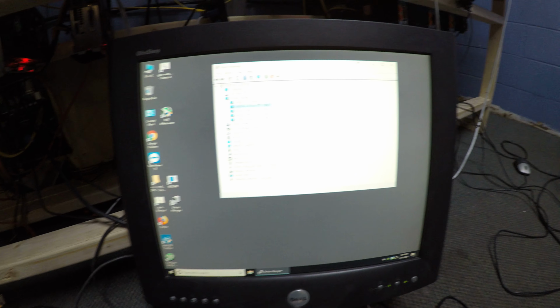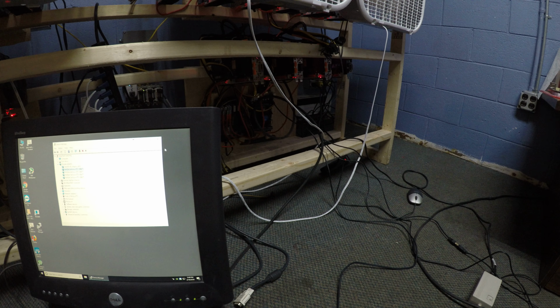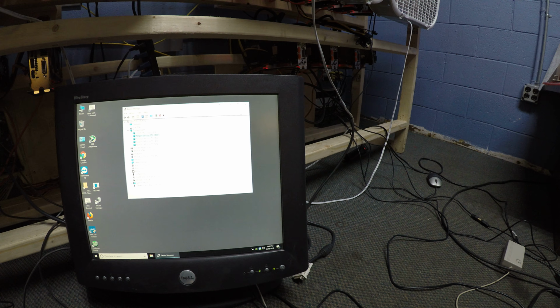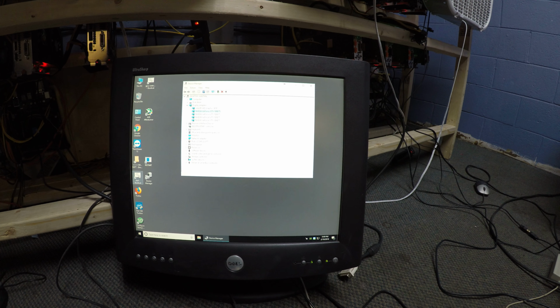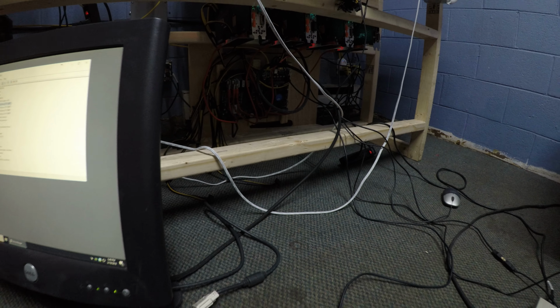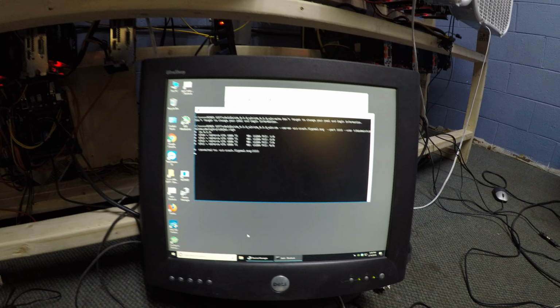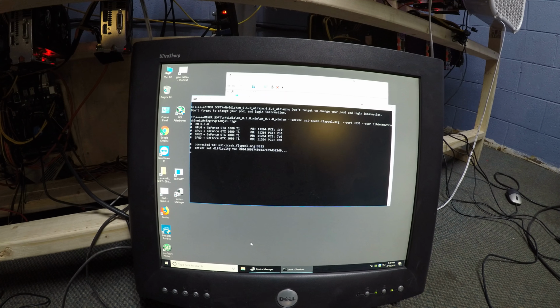Okay, here we go. I finally got it figured out. I had one of the cards connected to the power supply which did not belong to this system. That was perfectly fine when I did the other rigs, but for some reason it was not fine this time. Maybe the remaining power that came from that power supply was not enough to run one of these cards. That's why it was giving me an error. So I switched to the same power supply as runs this motherboard and the rest of the cards, and looks like this miner started working perfectly. Let's give it a try one more time.